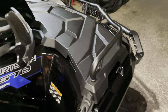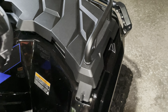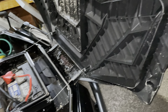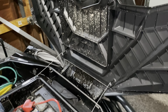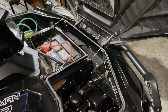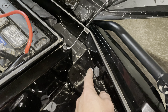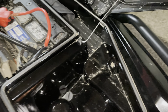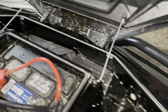Here's where the adjustment screw is. First thing is remove this really cheesy rubber clasp, open the equally cheesy and allegedly dry storage. Polaris calls it dry storage, but as you can clearly see from all the splashing of mud, it's anything but dry. The adjustment screw for the headlights on both sides — this one is here — just pop this off, pop off that rubber grommet. The other one is there; the process is the same.